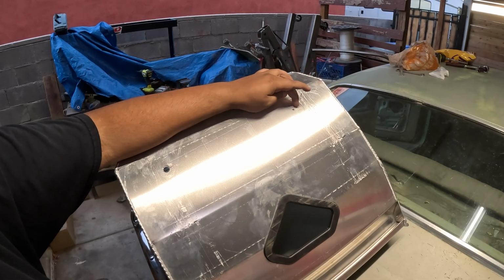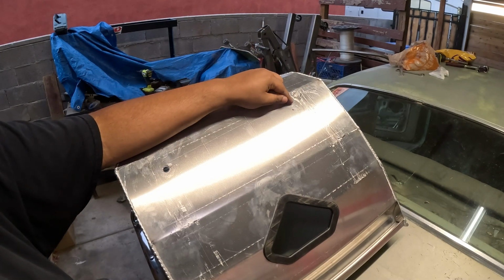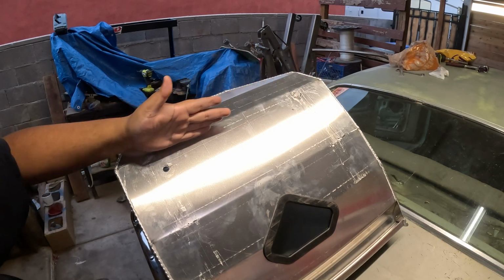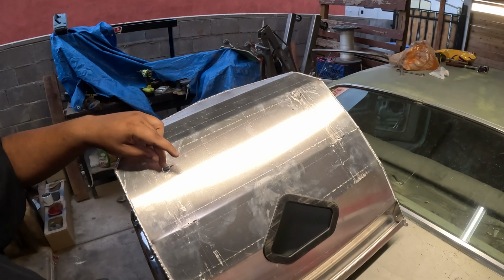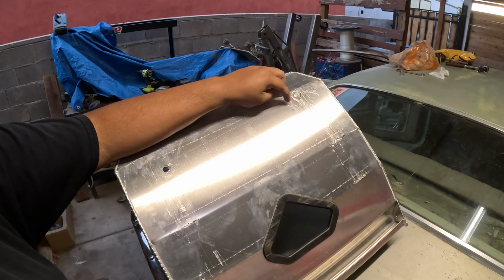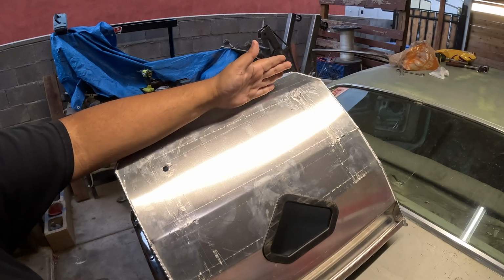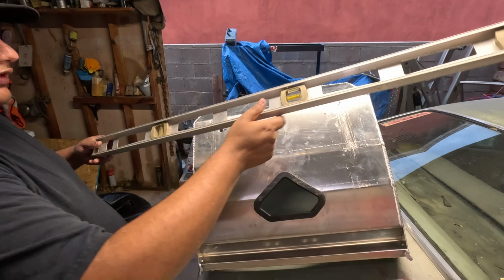going 1.5 inches down. And then once I get a straight edge and I go 12 inches across, that should let me know, hey, that's parallel to this line. That's my natural straight edge off the seat, and then using a straight edge off of the center of this hole to here, letting me know that this is about 1.5 inches down, 12 inches, should make that a parallel line to this line, therefore keeping it all straight. So let me go find a straight edge and we will move forward.